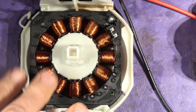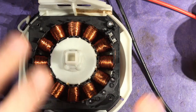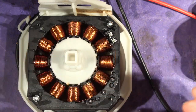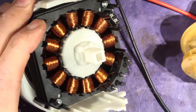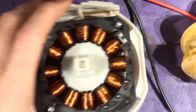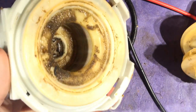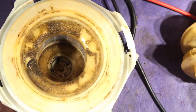It was highly intermittent - by the time we actually got around to testing it, the fault wasn't there. I was seeing an intermittent connection and couldn't work out what was going on. It turned out to be me touching the rubber pipes - my hand would touch the rubber pipe and I couldn't feel any electricity, but it was that contact with the conductive rubber pipe causing leakage to ground, which was throwing out the RCD on our consumer unit. So if you've got a Beko machine with this pump, strip the pump down and have a look.